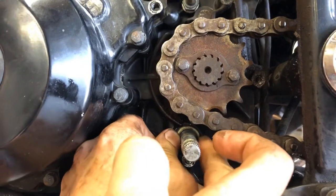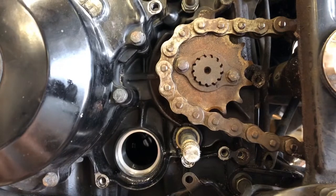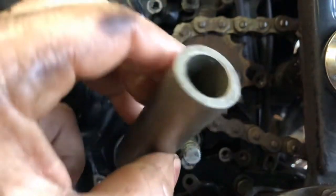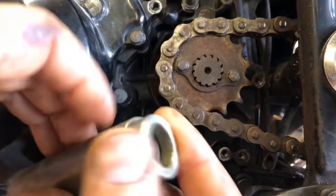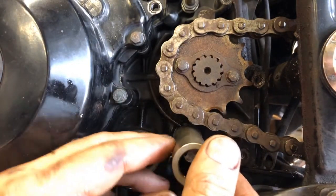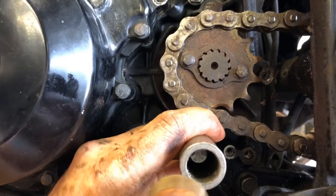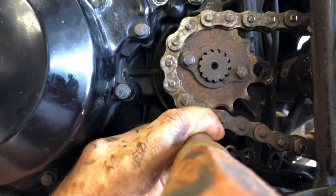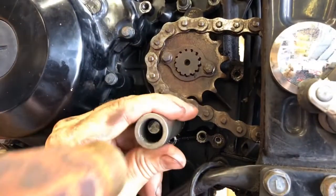Here's where it gets tricky — you need something to squarely drive that seal in there. I have some bits and pieces laying around, and it doesn't look like they're the same diameter, but that should work to get it started. Take it nice and slow and keep an eye on it — looking good so far. I'm going to back up here so I don't hit the screen.